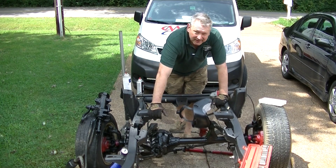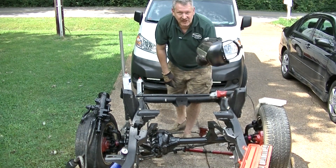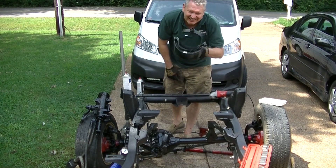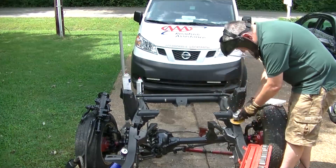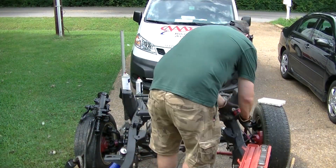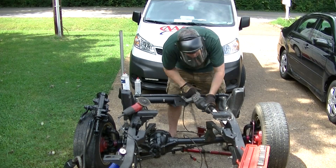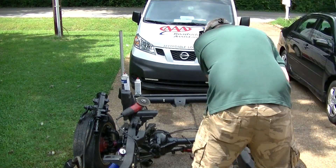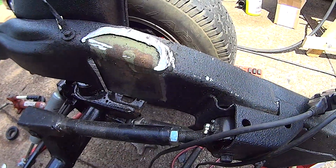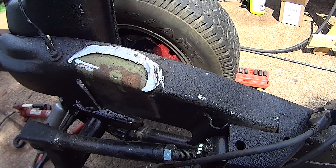It's time to cut the old six-cylinder motor mounts off. To answer your question, I do have a face shield — I just bought a new one, the Bionic, which is super cool — and I'm going to use it to keep my eyes from popping out of my head. I got it cut off, and now I'm going to take a grinder and just grind it pretty flush, not all the way. It doesn't have to be perfect, but you don't want a knife blade edge there. We'll get her flattened down and treat the frame, and that'll be good to go.